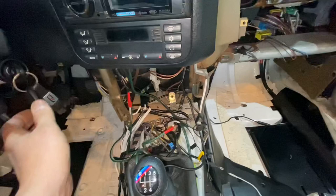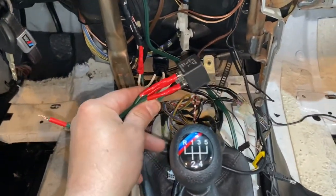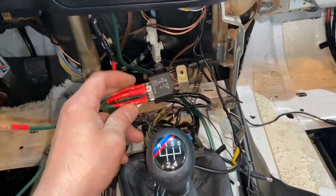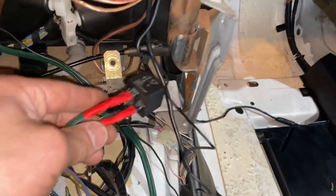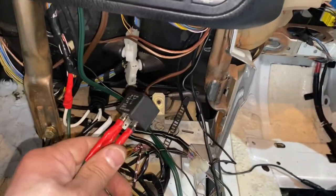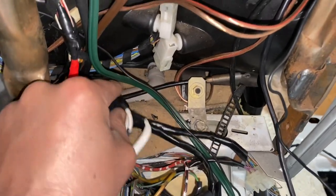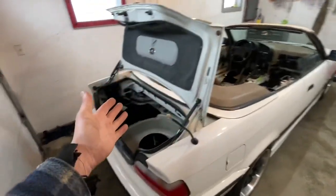Stage one is complete. Now let's get into hooking up the switches and the motors. One more thing: this relay just sits here inside once you put everything back together, but you've got to get electrical tape and wrap it all around — you can't have any exposed connectors because it could slide and ground out on metal. I did the same thing for the windows relay — just wrapped it up and it sits there.